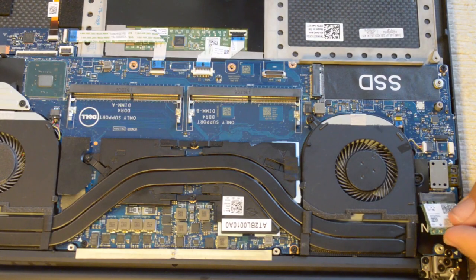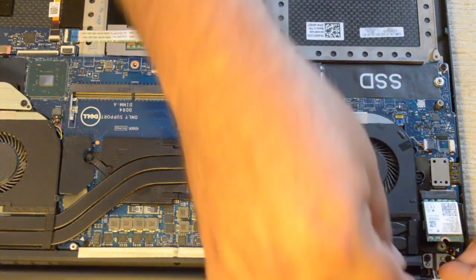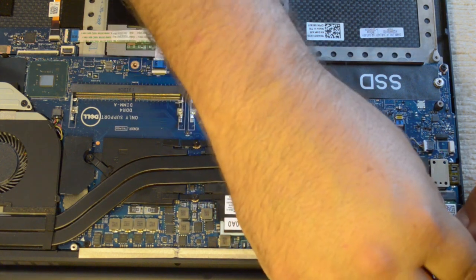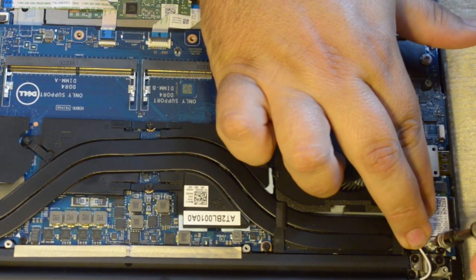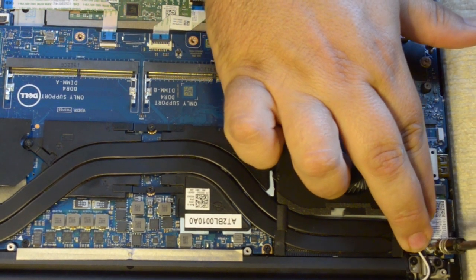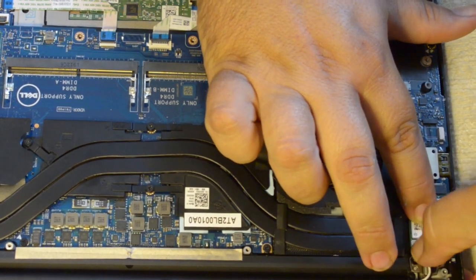Next, I replaced the Wi-Fi card. Sorry for the position of the camera. I replaced the Killer 1535 card that came with the laptop with an Intel AC 9260 card. I'll have a link in the description. Remember, if you don't have an Ethernet connection, you should download the drivers for this card before you begin this process. Again, remember to match the antenna connectors to the right color. Once you get it into place and attach the antenna connectors, you can use the single screw and cover plate to hold it into place.